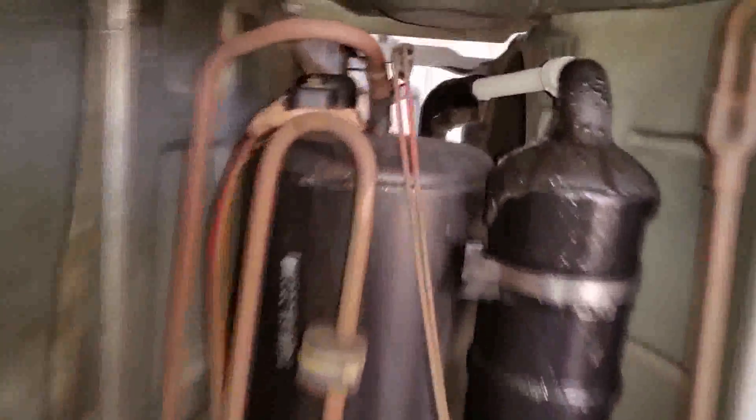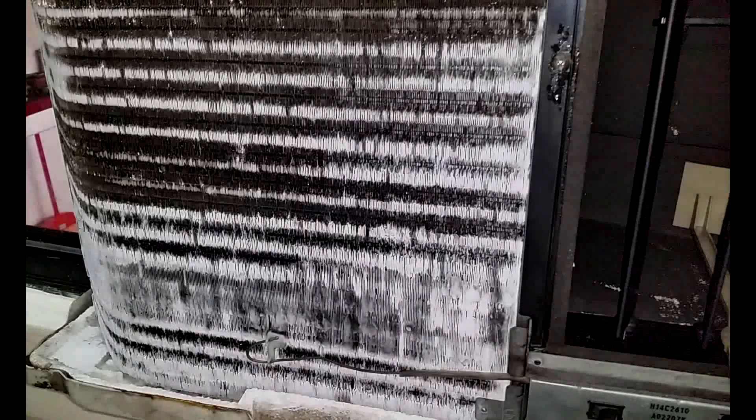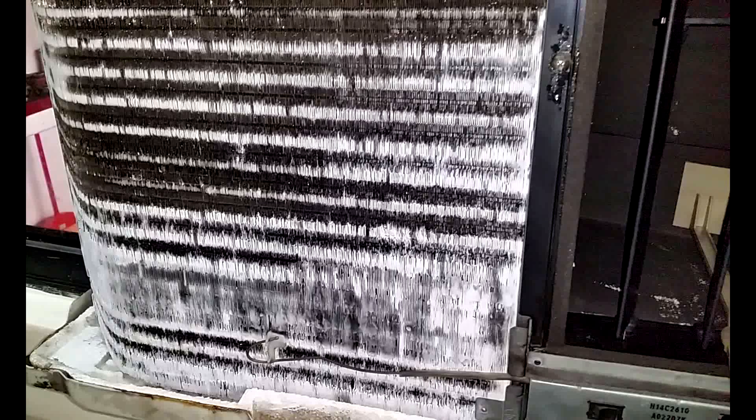I had to take this air conditioner to a technician. He inspected it and told me the air conditioner had a lack of refrigerant — the liquid side pressure was around 40 PSI. He then took the condenser coil and evaporator coil separately and checked for gas leaks by pressurizing the system, but unfortunately he was unable to find any leak.